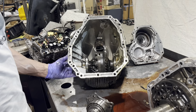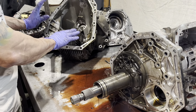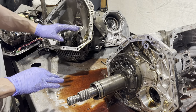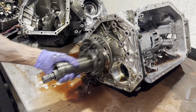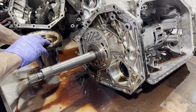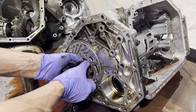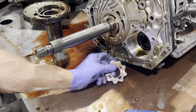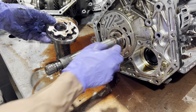You set depth with these shims and side-to-side with these adjusters. If you're not changing any parts though, you can reuse your shim typically and put the adjusters back to where they came from. Sometimes the gears stick to the transmission case side — they ride on here, so you want to look at this surface.